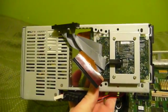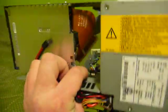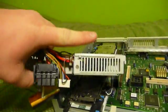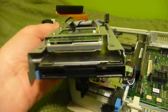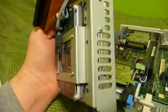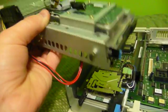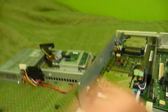I told a little bit of a fib — you do need a little bit of help from tools to undo one screw that holds the entire cage assembly in. But there you can see the floppy drive, the power supply and its connectors, just to give you an idea of how small it is — that's my finger right next to it for scale. At the bottom you can see the hard drive, which is a 2.5-inch parallel ATA, or IDE, laptop hard drive. It needs to be less than 15 millimeters in height. The machine has a 528-megabyte system BIOS capacity limit, so you'll need to use a disk manager to get the full capacity of a drive if you go beyond that mark.